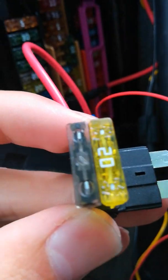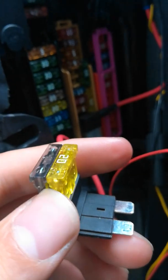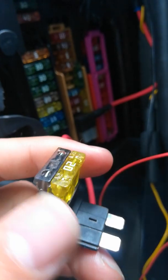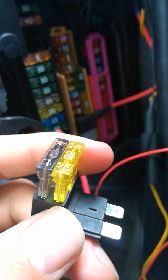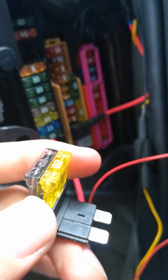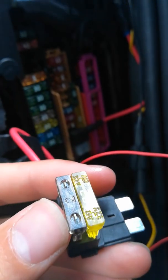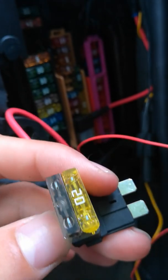Basically, if I take one out, they have like two fuse slots on them. You need to use the inner one — that's the fuse for the component that you're bridging. So for example, this one is the 12-volt cigarette lighter, so the inner one here is what you need to use for that. And you must have this other fuse for the dashcam, otherwise there's no connection, which was what was happening for me.